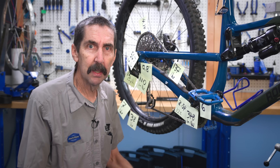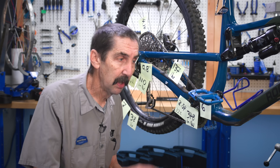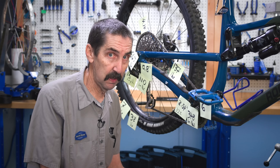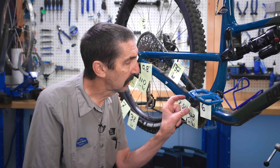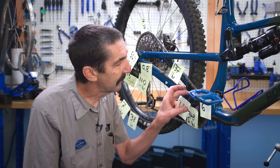We're going to use the torque formula: six inches times 58 gives us 348 inch-pound torque here. But that doesn't really get us what we need — we have to keep transferring. We're going to use another lever called the chainring. It's actually a little wrench, but what we need is not the 32 teeth — we need that radius.